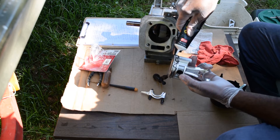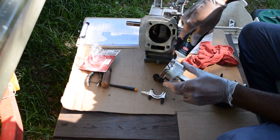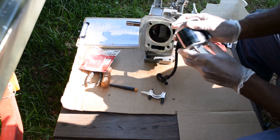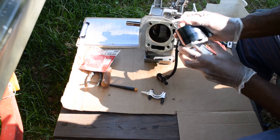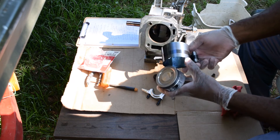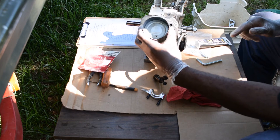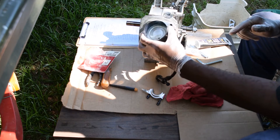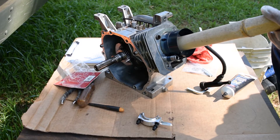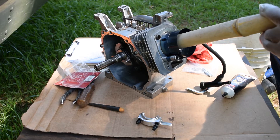I want plenty of lube on the actual rings. I'm going to try to make sure that the compression ring is even all the way around. There are little notches here, and those notches keep this from sliding down into the cylinder itself. I'm just using some old bamboo and just tap it — not hammering hard, just lightly tap.